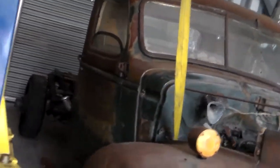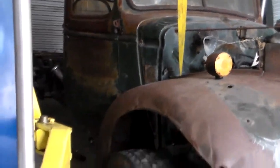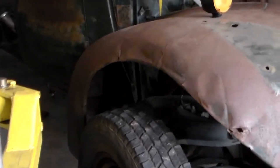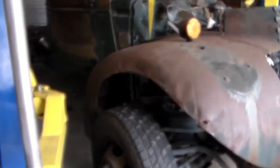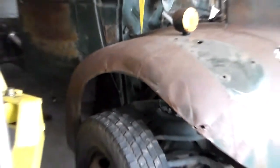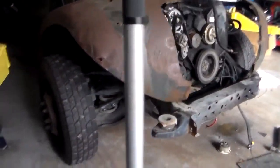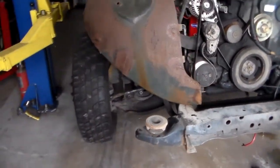Now we have to tuck the cab lower onto here. You could probably see it better from this side — let me zoom in. Right there, where it sits on the frame, I can cut that up and I can drop it another two inches. Let me get this side of the frame cut off and I'll be able to lower the front end down.